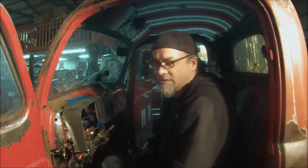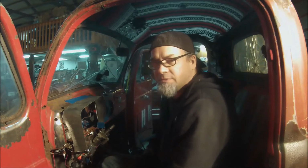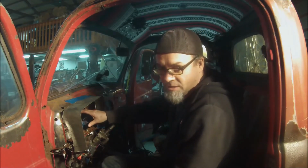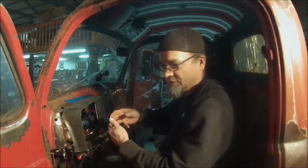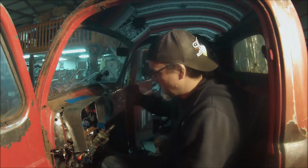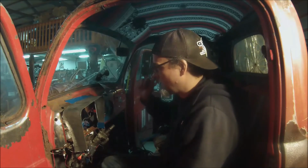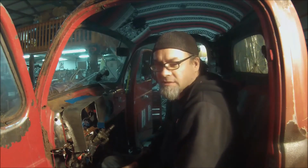I know this probably seems like it's dragging on a little bit. This is all under the swap. A lot of people, I'm sure, just think of an engine swap as you pull one motor out, you put another one in. But anybody that's done an engine swap knows there's a lot more to it than that. If you don't take an opportunity like that to make improvements on your vehicle, in this case my dash, I could have kept everything pretty much the same as it was, dropped that motor in, and when it didn't work, I'd have been lost, because I would have had the old system tied in with the new system. This way it forces me to have the new system wired from the get-go, from the key to the relays, the solenoids, to the computer. I should be able to turn the key on, hear my fuel pump kick on, fan kick on, whatever. That's my goal. So yeah, this isn't going to be a short and easy 10-minute engine swap.